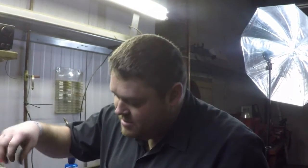And if you find that you've adjusted up and it's still a little bit of slop, give it a little more turn down in. You know, go an eighth of a turn at a time until you get it so you have a little bit of play, but not too much. It is really quite subjective.